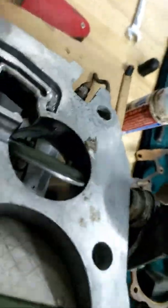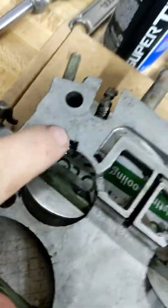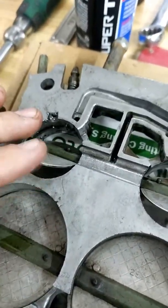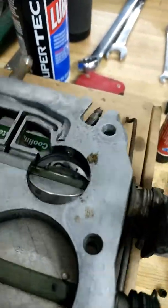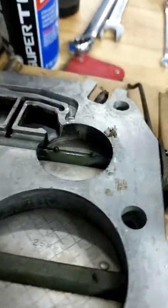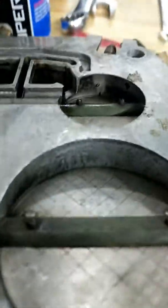There's another port in there — you might not be able to see it, but there's a port there and a port right there. These ports are apparently called bypasses, so they let more air through. The problem I was having is no matter how closed the butterflies were — I had them literally to the max they would close — I still couldn't get the idle down.